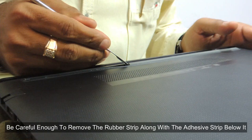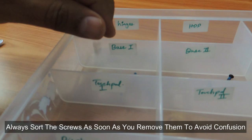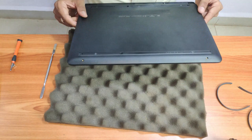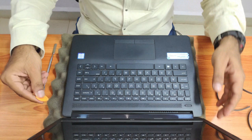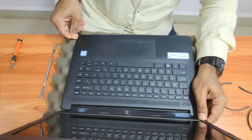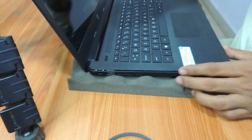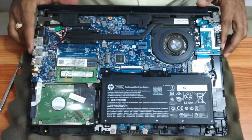It's a little poor design that HP has done — three more screws: one, two, three. Once you have removed these screws, put the laptop like this and start prying from one of the corners. You will see that the base will give away slowly. Remove it like this and the base is off.